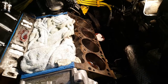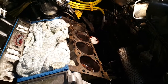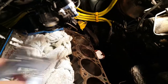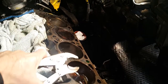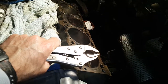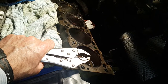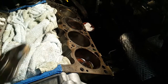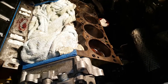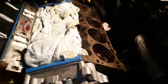The other way to get the dowel pin out, which doesn't usually work, is to take a very strong vise-lock pliers. I used this to try and snap onto the dowel pin — it snaps on and bites into it, deforming the pin because these dowel pins are not really hard. But then when you try to twist it, it just turns off. So that didn't actually work, and you're probably just going to squish up the dowel pin.